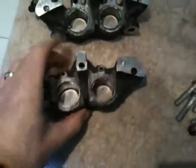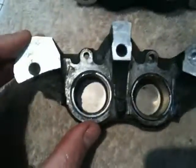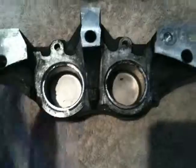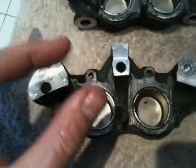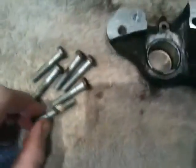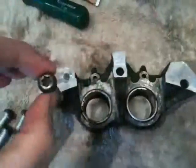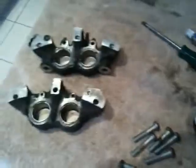Okay, I've been smearing on Vaseline, and honestly, all the seals just sat in nice and crisp, stuck in place, and then the piston pots just slid lovely, nice down and in. So that's them all nice and in. These are the bolts to go through. I'm just going to copper ease them up and fit them back in and put the calipers back together. And I'll show you the next stage.